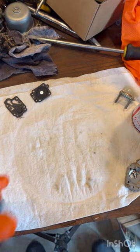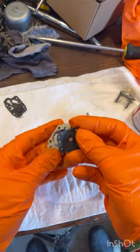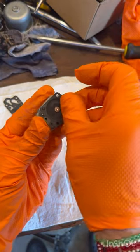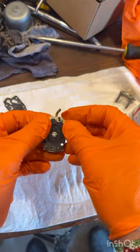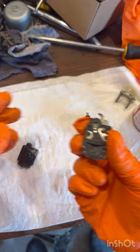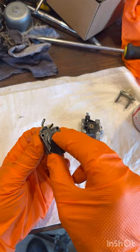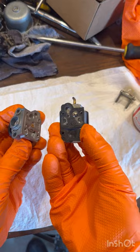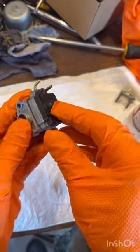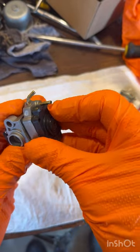Once that's done, go ahead and move your basin and bring your parts together. Grab your gaskets. This metal piece goes down like so — put it on those pins at the end and send it down. Then this piece goes on the other side like that. Make sure your gasket is in place and it all lines up. These have pins to guide alignment — see these pins right here, they go in these guide holes. Line them up like that.